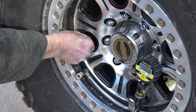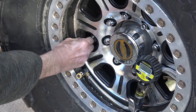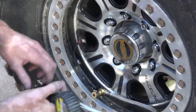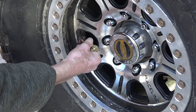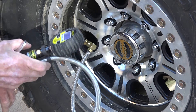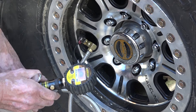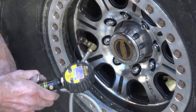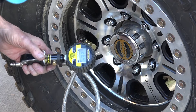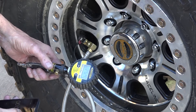First we're going to remove the valve cap. It's important to use this valve cap because it locks the lever that operates the deflator. So we're going to hook up the gauge — we use the Power Tank gauge for inflating. The nice thing about this setup is you can use the same gauge to inflate and deflate the tires. We're at 26.3 psi. It's a little cold today so the pressure has dropped slightly from 27 when the tires were a little bit warmer. So we're going to see how fast we can get down to 7 psi.